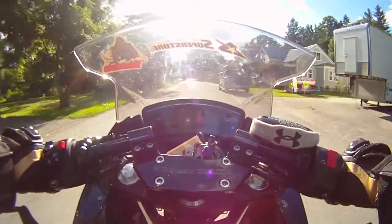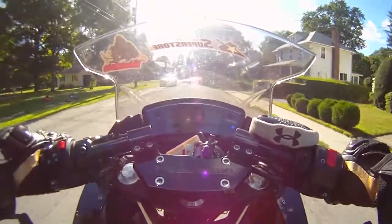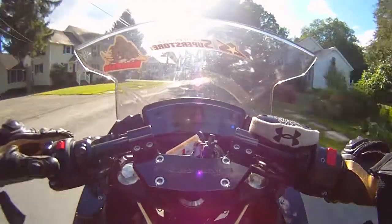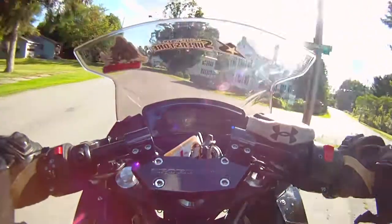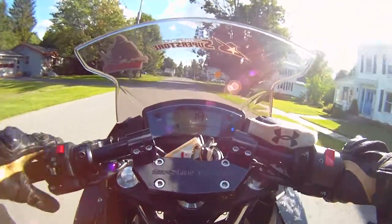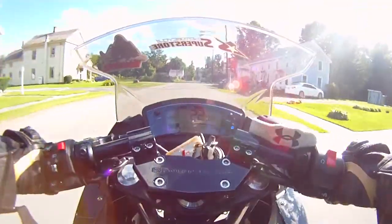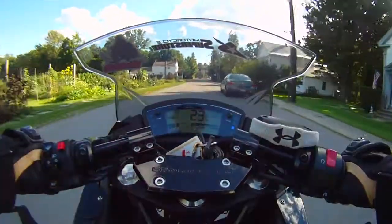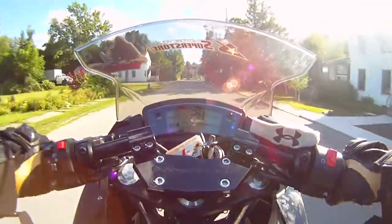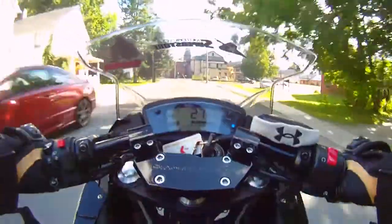Car's following me, they won't leave me alone. You can even let the clutch out, and if you don't match the RPMs, you'll kind of bog down, but you won't stall it. So I'm in second gear right now. Oh, and I'll go through it. So we're at 3,000. I'm accelerating. 4,000. Clutch in, up. Give it a little bit of gas, and I'm good. Now I'm in third gear.